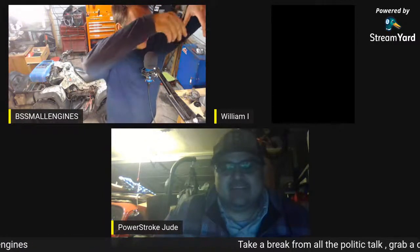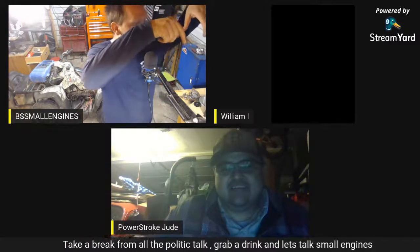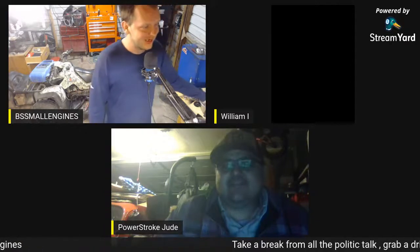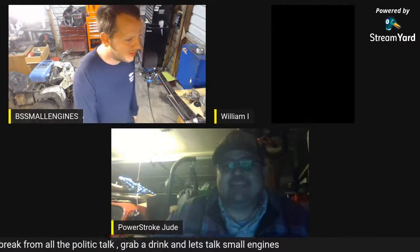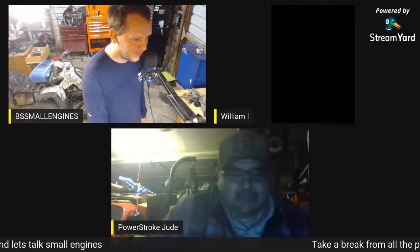Yeah. And then the one on top, I broke something off the side of the cartridge thing there, and at first he made me believe it was my fault, and then he laughed. He said, "This is actually a common problem. I already have one ordered, and it's on its way." Yeah, if you're talking about the plastic housing or the plastic cap, those things crack, and if they crack, you can't even see it. It's a hairline crack, but you start it, man, it's like a little geyser, shooting fuel up in the air.